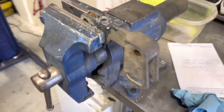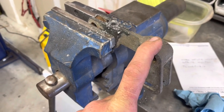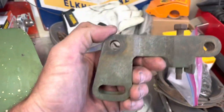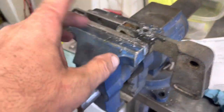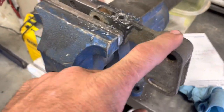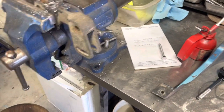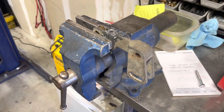First order of business: this is linkage in the headlight assembly. It's got an adjusting bolt on it — this one turns freely, but this other one broke off no matter what. I've been waiting to deal with it, but I'm going to drill and tap it and put in a new adjuster nut from Corvette Central. Most of these parts are all available; it's just a matter of putting in the work and getting things back the way they're supposed to be.